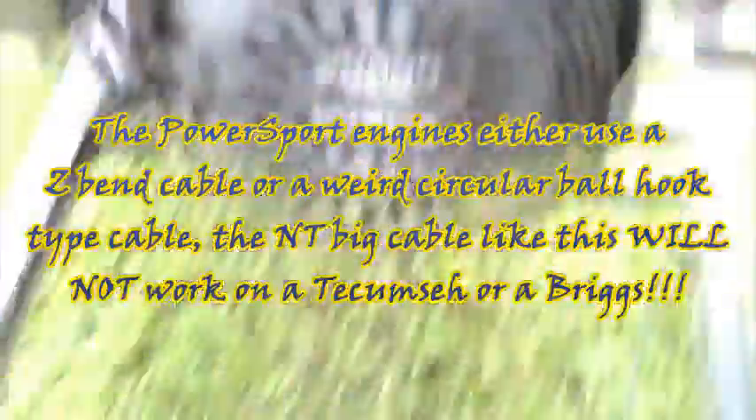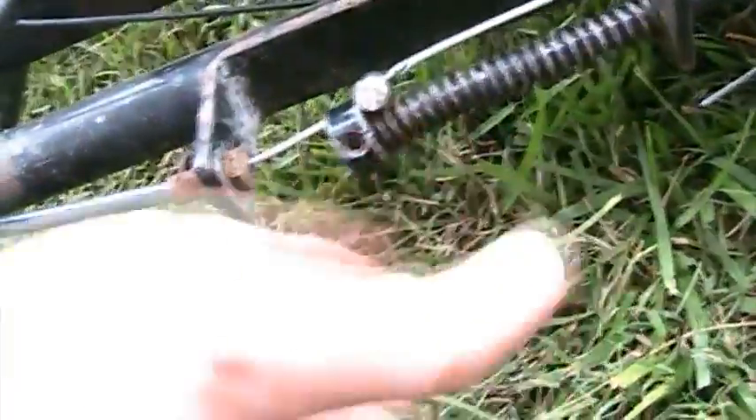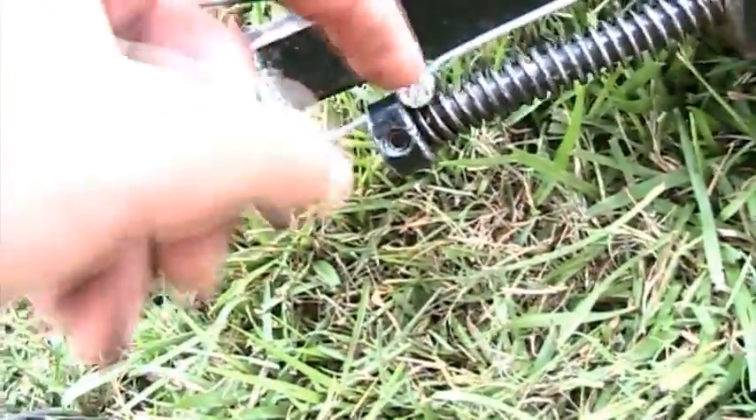In my last video I showed how I rigged up the accelerator, but today I did it right — the way it came from the factory. If you have a go-kart with a similar setup, you can get one of the Northern Tool cables that have a fat end on the bottom. Run the cable through with the fat end sticking out and fish it on down. Then get one of these cable stoppers — still about 99 cents to a dollar. Get the one with the big round hole, not the hexagon one. Fasten it in, and if you don't have a go-kart like this, you can just drill a hole through the pedal with the spring on it, put the cable through, and put the cable stopper on it.